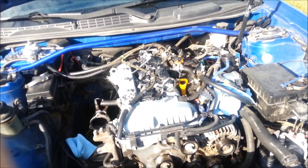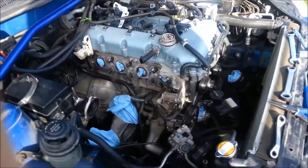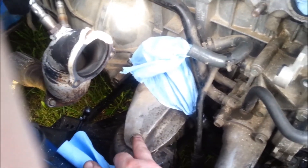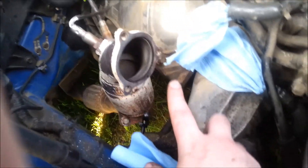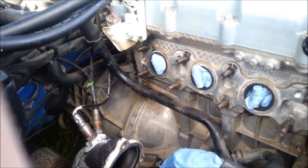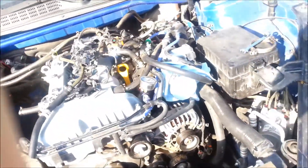Make sure that if you're stopping for the night you have something blocking the valves from direct exposure — you don't want sand or dust in there. Once you get all this out, you have free access to this bolt here, which is your motor mount bolt. Just undo that and you'll be free of the motor mount. You've also got a transmission bolt right there at the edge of that blue thing, and then you have to take the rest of the transmission bolts out.